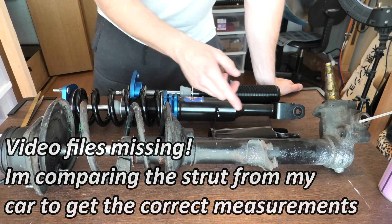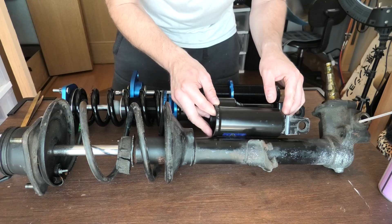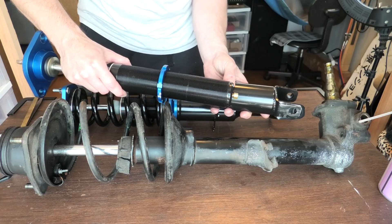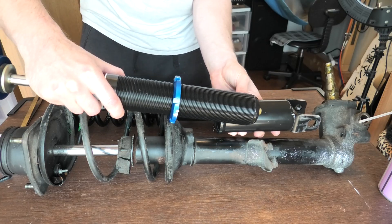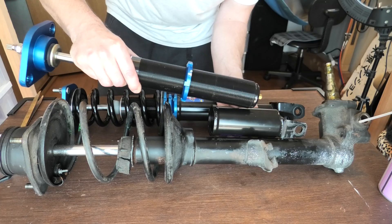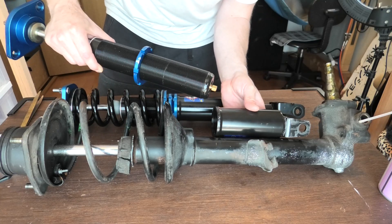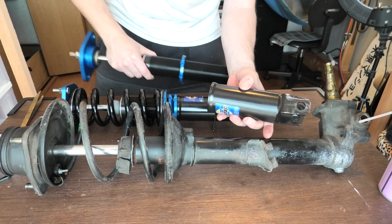Where do I cut it? Just eyeballing it for now before I get proper measurements. I've been lining it up and scratching some lines. Remember, that's a minimum of five centimeters — the diameter of that — so that's the maximum height you can raise your damper. If you want to go lower, it screws down, but only to where I've cut that tube off, because it's going to sit on that little edge. So you need it cut off there at minimum.